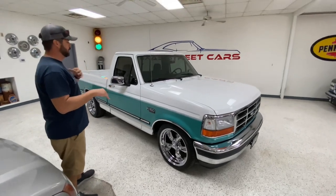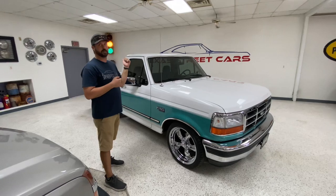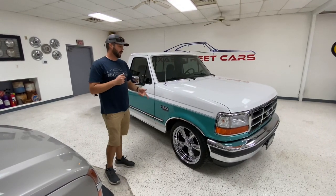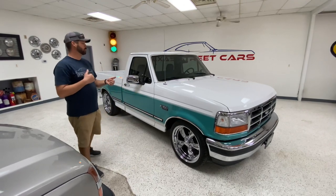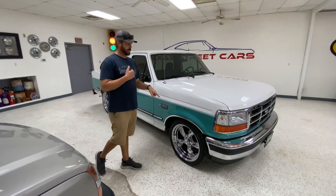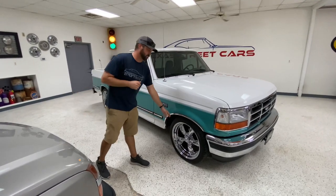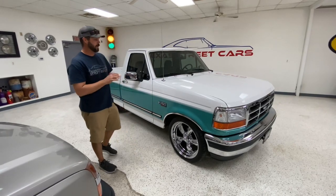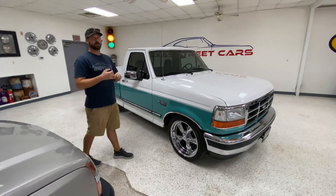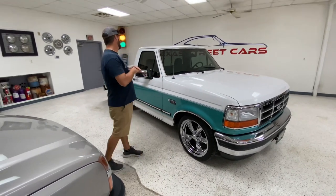We did a suspension to it. It has a DJM 3.5 drop kit on it, which is their I-beams in the front and then a flip kit in the rear. No C-notch on this truck. You don't have to C-notch these like the Chevys. Wheel-wise is a Torque Thrust chrome 20x8, and 20x10 in the rear. Kumho Ecsta PS91 tires, 245 and a 275. These are like a 320 treadwear tire, so they handle pretty good. And it's got the Ridetech adjustable shocks, so you can kind of mess with that. Just had a professional alignment done with the right bushings in there to get everything dialed back in. We have the sheet for that. But besides that, exterior stock.